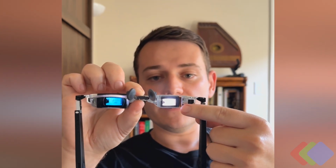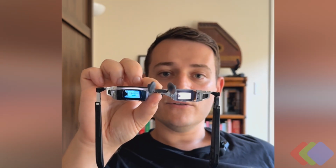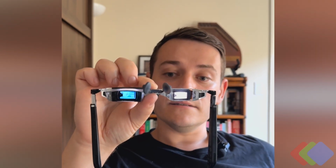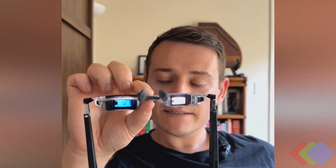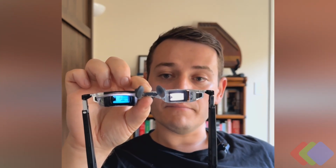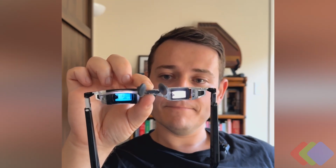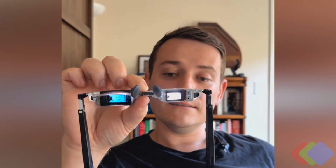And this is essentially the full 5000 nit display that Sony sells as a flat panel that we then integrate through our optical element, and through all the various optical losses is where we can get around 400 nits total delivered to the user's eye. There's a lot of inefficiency, obviously, in this design, and we have to take it as is because of the nature of the birdbath optics and the reflection paths that we have to use to magnify the focal length of the system. By design, it actually loses quite a bit of light throughout the system.